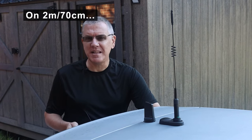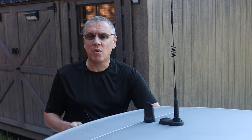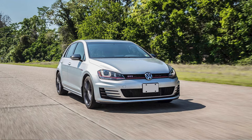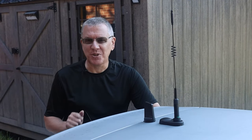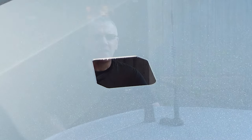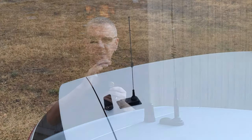The lack of metal mounting restricted me to using half-wave, no-ground-plane antennas. Half-wave antennas satisfy my needs the vast majority of the time, but sometimes I prefer to use my 5/8-wave or even a 7/8-wave antenna. Sometimes I even prefer a smaller quarter-wave antenna for a discreet look. All of those antennas require a ground plane or an electrical bond to the car, as do my 6-meter and 10-meter antennas. I also discovered a small problem: at only two inches wide, the mount was just a millimeter or two wider than the diagonal of the 40 millimeter hole, which compelled me to use an adapter plate between the roof and the mount to prevent leaks.